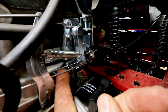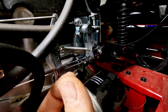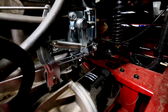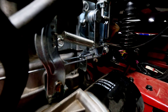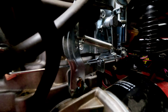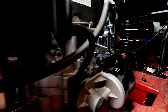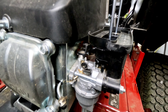Now I can snap the other piece at the back side in. It kind of snug-fits in there. This will wear out over time - it's going to get bent and pinched and eventually won't stay in. It's just a slip fit, so this is an issue I've now seen twice in just a few days. To verify it works, when you pull your choke it's pulling on that rod here, pulling it right back, and pulling the choke all the way over.